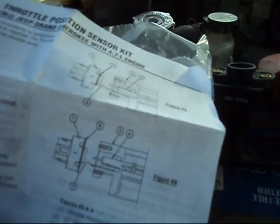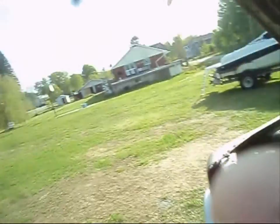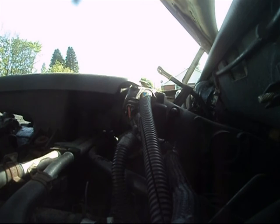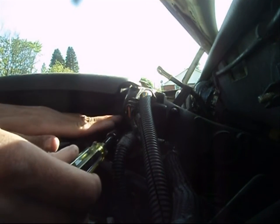So we're going to go ahead. We are dealing with Torx bolts, so I'm going to get the proper Torx bit, and we're going to remove the unit from the throttle body assembly. And we're going to change one of these, delete the code, and see how the engine performs afterwards. All right, lads and lassies, T20 Torx bit on a nut driver. We'll be just fine.